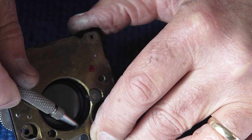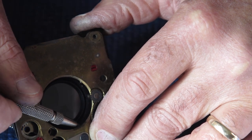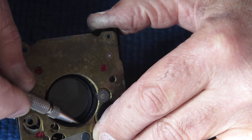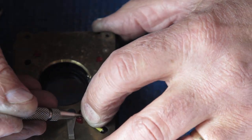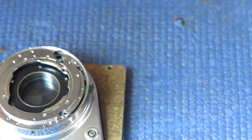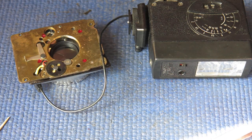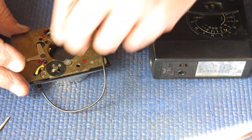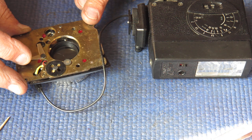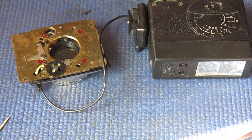And then I'll get an electronic flash out and check that it works. Cock the shutter, check that the flash sync is set to X, find an electronic flash. Well, I found a flash. And it seems to work. Test it once again. Wait for that. Yep, okay, so the flash is certainly working, so my connection is good. That shutter is ready to go back on the camera.